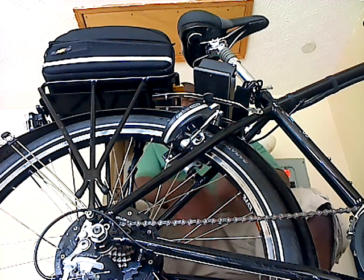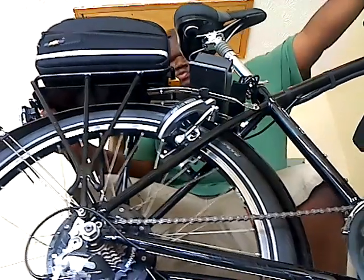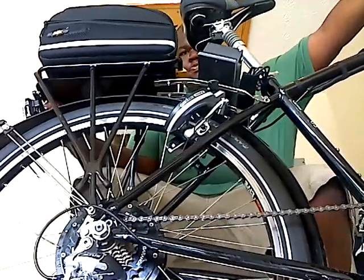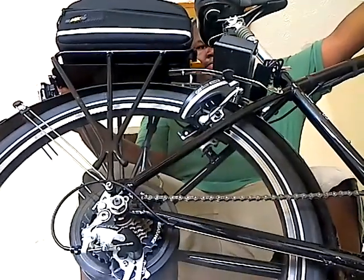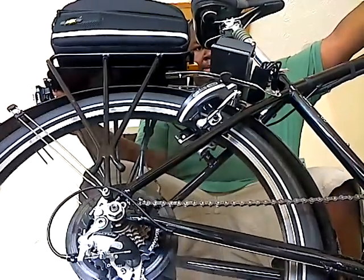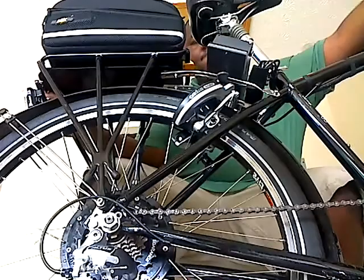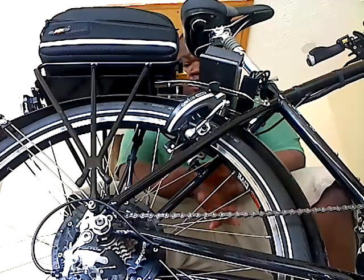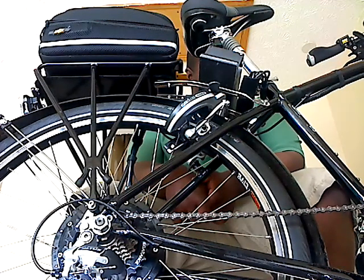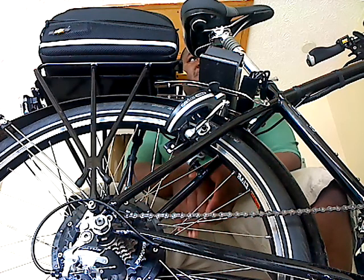So it's always like an amperage surge or something that causes it to lose sync. But I'm going to spin up the motor and show that it is spinning up correctly. So give me 1 second. Oh, I got to turn the controller on. Okay, so the motor is spinning up pretty good. I also put a metal gear in here, that's why it may sound a little bit louder than it should. But the problem I have, like I said, is losing sync, or basically it shudders or hammers the gears.